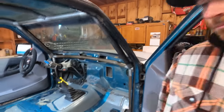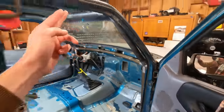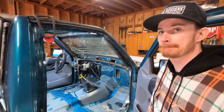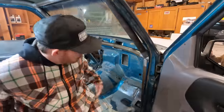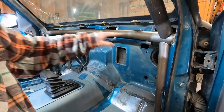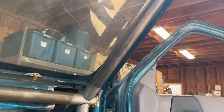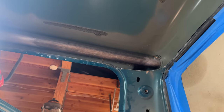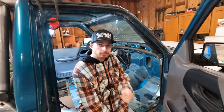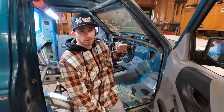The cool thing with doing the dash tube first is you literally just get it fit and tack it in. It also makes it easier because typically this tube coming all the way up and out to the back of the cage is one piece, which is hard to make with all the bends perfect and tucked as much as you want. Starting with the dash tube makes it simpler — gets two separate tubes easier to work with, and allows everything to be tucked as tight as possible. It would basically be impossible to get it this tight as one single piece going all the way through.